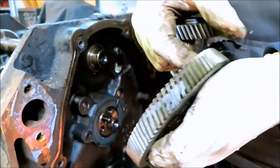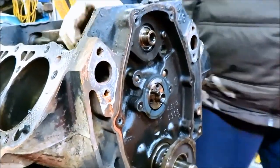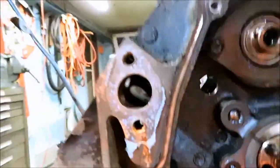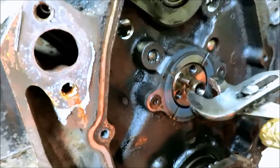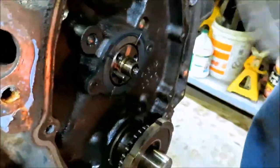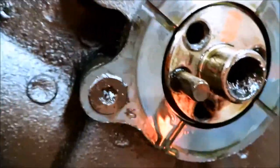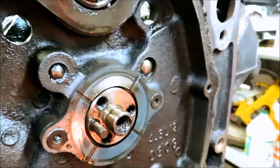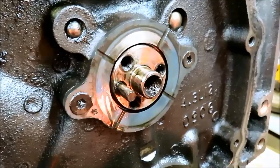Some gears which are in relatively good shape — the wear is alright. This thing had some valve issues — I think it had a sticky lifter, you don't know for sure unless you check them. These are Torx fittings — we're in more trouble. We'll leave that on. Guys, more Torx — they don't want the average backyard Sunday mechanic touching these things.